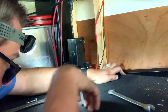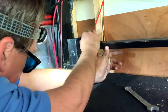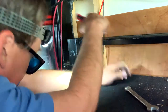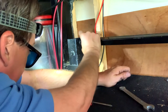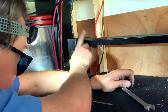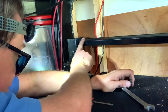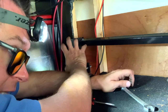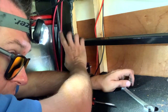Alright, now you're ready to attach the drive shaft back to this little piece right here. All you've got to do is line it up and put your bolt or pin back through there. Now the important thing with this is — because this drives both sides up and down the same, they're not independent at all, they're linked together — before you attach this, you have to go outside and measure and make sure they're both extended the same length. You can then manually spin this up or down to get it where you need it, and then you're good to go.